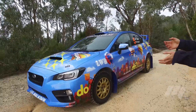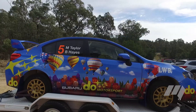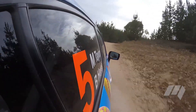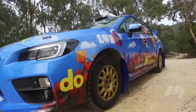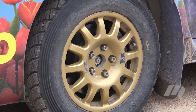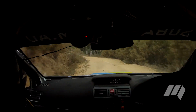The first thing you'll notice is our wonderful colour scheme — that's definitely something you don't see on the road car every day. The big noticeable thing is how much higher we run the car to cope with the gravel surface. The wheels we've got here are 15-inch, slightly smaller, really durable, and they're fitted with Kumho rally tyres, designed to flush away loose gravel on the surface and dig right in to get as much grip as we can.